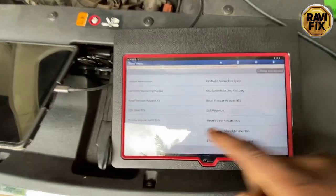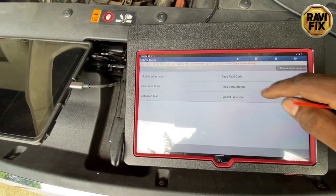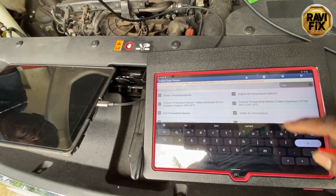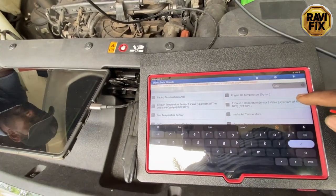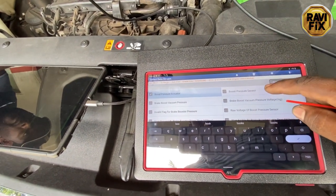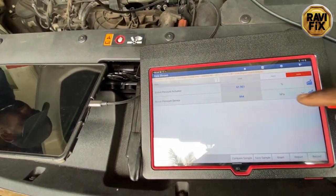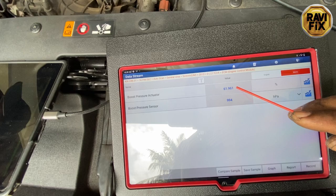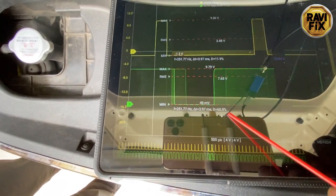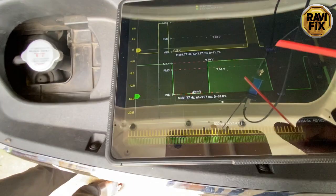This diagnosis would have been easier if there were feedback data available in the scan tool for the boost pressure controller actuator, but unfortunately I only found boost pressure actuator pulse width modulation input signal in the scan data - no feedback signal data. So scoping this signal was the only method to confirm the fault confidently. In the scan data you can see just two data parameters: boost pressure actuation PWM and boost pressure. The scope confirms 61 percent PWM matching the scan tool value.